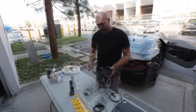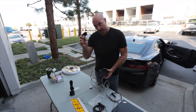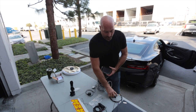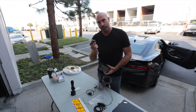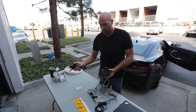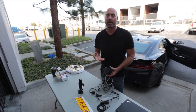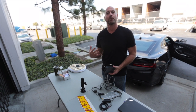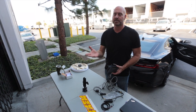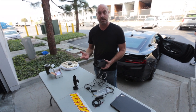From here, we're good to go. We'll take our GPS antenna and put that on top of the vehicle, plug our OBD2 CAN adapter cable — the plug-and-play adapter cable — into the OBD2 port on the ZL1, and we'll power it up from the 12-volt adapter plug-and-play cable that we make. We'll mount the RAM ball to the arm and we're fully installed. From there, we pull the data port, take those OBD2 channels, and bring them into dash design software. We've already got templates, so most of that stuff will transfer to our templates, but we'll do a little bit of configuration to make sure we have all the channels on the dash that we want to see.